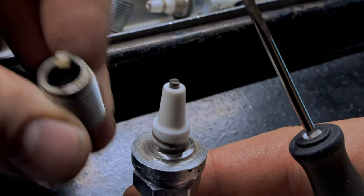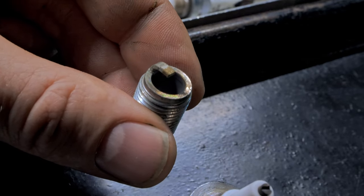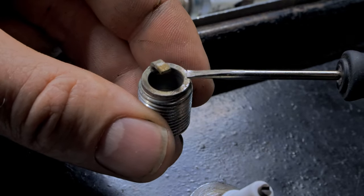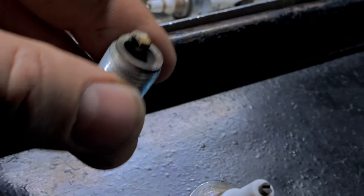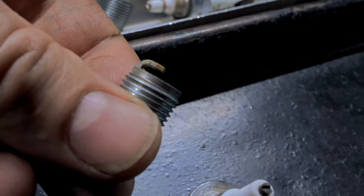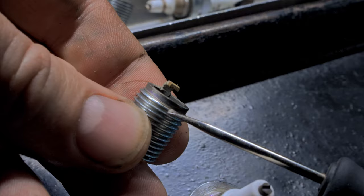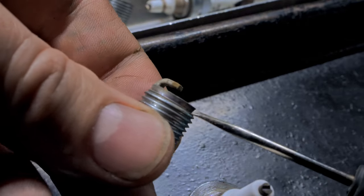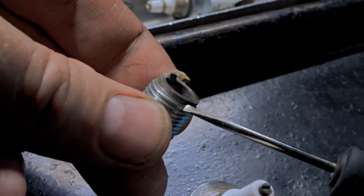But if you look at this one right here, you can see it has a good bit of shininess, still has a good bit of cadmium, and the more you burn off all the way around, the more heat it's giving you. And of course, if you turn it sideways, you can see that we're still not getting heat. See that discolorization right there? We're still not getting heat into any of these threads. So I don't really want to make any changes based off of this.